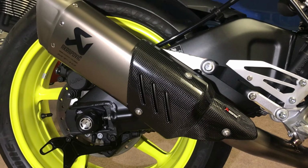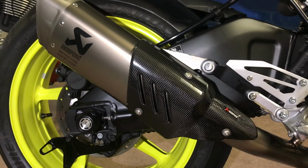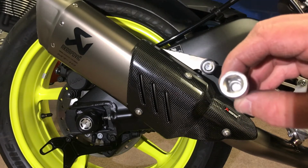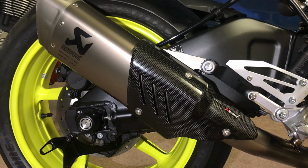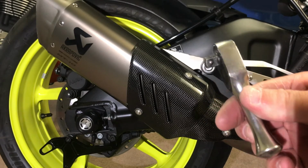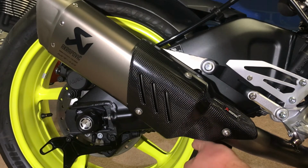Unfortunately, I don't have the right wrench. This small little tension wrench is only 1/4 inch drive. The T45 I have is 3/8 drive. So unfortunately, I can't tighten this clamp to its correct tension. However, we have done our best with this, and as I said, it's only short. You can't pull that much tension onto it.